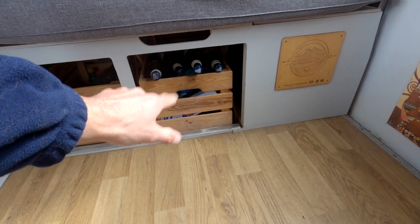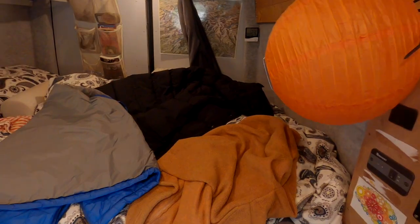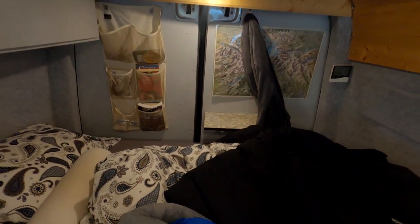What does happen is I have some dry food stored here and there's a little air vent which goes into the garage at the back, which causes enough air to be sucked in and through the back. The air comes up through there, slowly comes across the roof, comes back down, and creates a really good circular airflow. Maybe I've just got lucky, but it works really well. The back of the van is the last to get warm, as is the front, but the circulation works really well and there's certainly nothing damp in the garage.